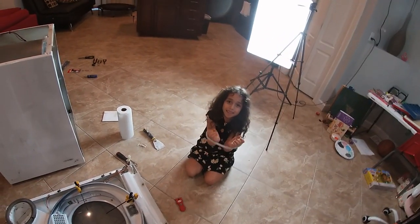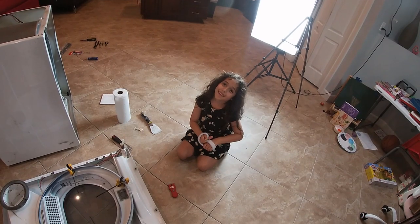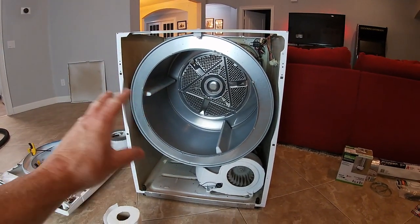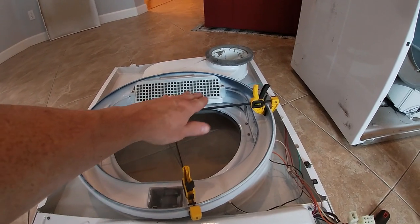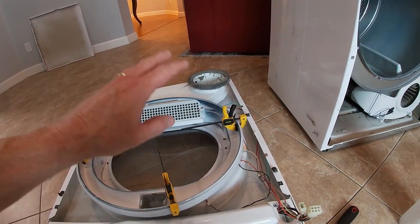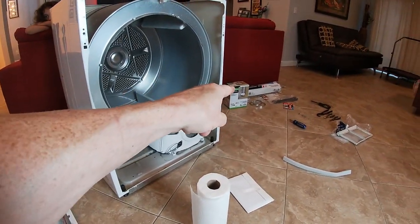My producer asks if we're ready to get things reassembled - yep, let's do it. She's super excited because she likes building with me. At this point we have our drum back in the machine, we've got everything cleaned out, we've got our new bearings in and lubed, we've got everything cleaned up on the door, we've got our new tray, we've got our new felt installed, and everything has been put back together correctly and is just waiting for this to dry. So I can reassemble the door and then test it. While we have a minute, let's go over the venting.